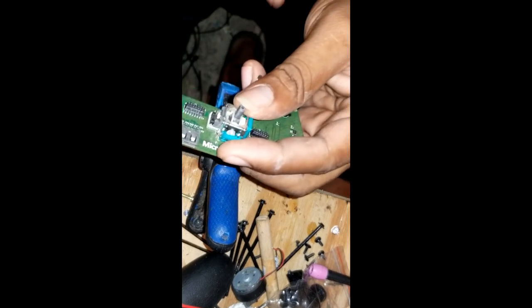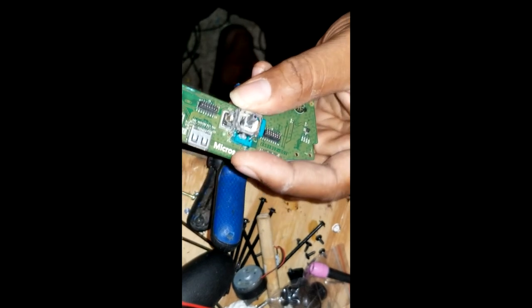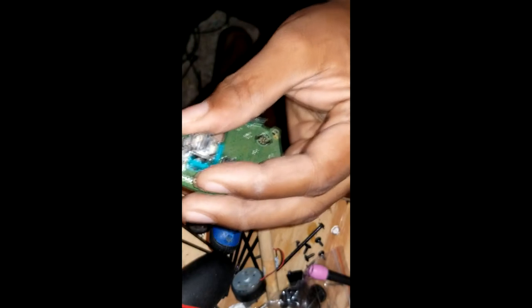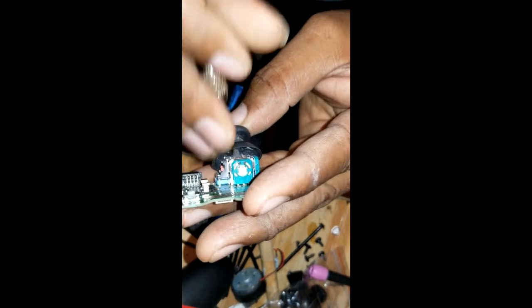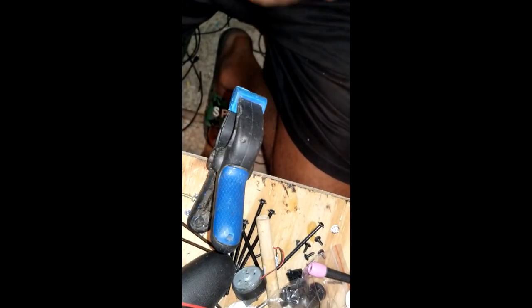But they have another issue, because the controller suffers from water, juice, fluids, liquid, whatever you want to call it. That causes the controller to malfunction because water gets inside. Let me put the cap back on. Let me show you with this. Water runs down through these sections, and when you pull it down, the water gets into this, the juice gets into this, then dirt mixes with the juice, everything mixes together, and it causes your controller to not move properly.